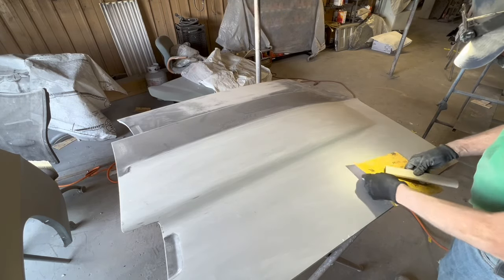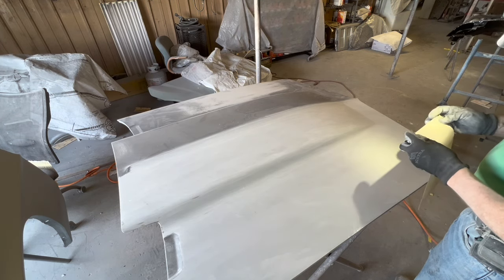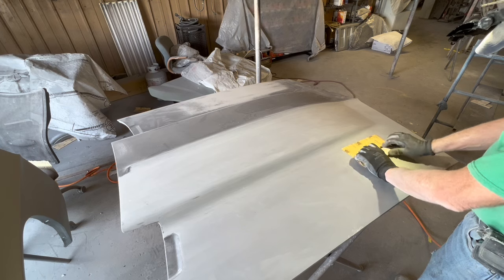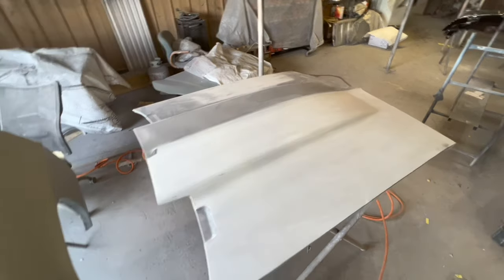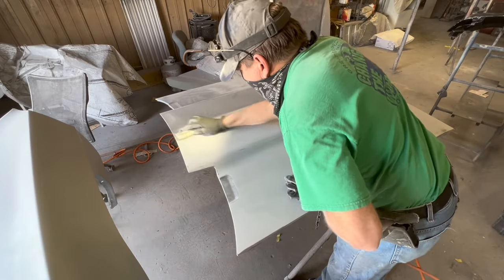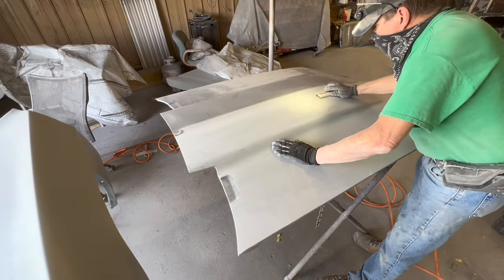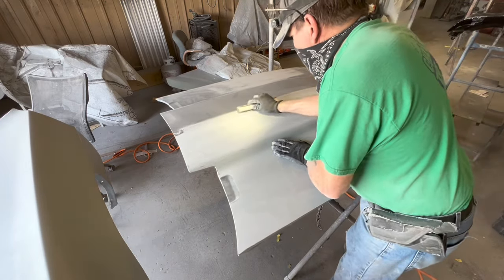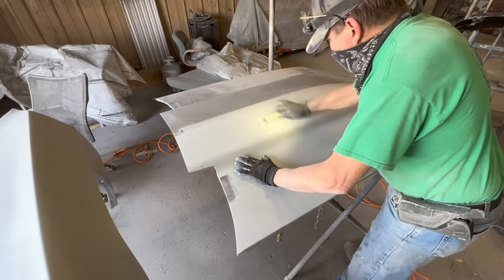Now, I'm always leaving the sheet of 320 that's on the stick on there and just rolling up new sandpaper on top of it. That's my necessary padding. Like the Resto clowns are using, a single layer of sandpaper on a plastic block that clogs up way too quick and causes ripples and discrepancies in your surface. Two sheets of sandpaper on there, which is like 10 layers of sandpaper, gives you enough cushion to allow for some relief from the buildup of the sludge, we'll call it, even though it's got no water in it, I'll still call it sludge.